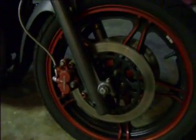Like I said, front end's off an '82. Did a little bit of painting, rebuilt the front calipers, added some stainless brake lines, replaced the fork oil — just things you do when you buy a vintage motorcycle. You can never have too many new parts on a vintage bike. It usually breaks down on you at the least convenient time when you don't have any tools or anything.